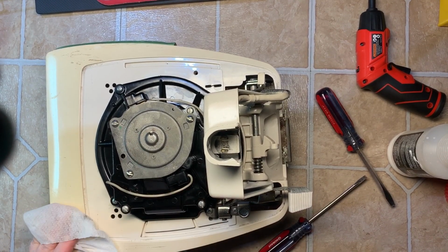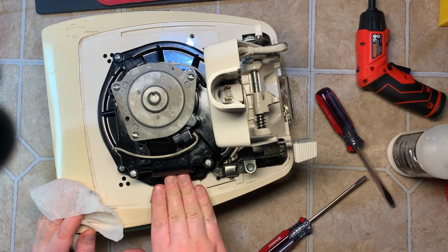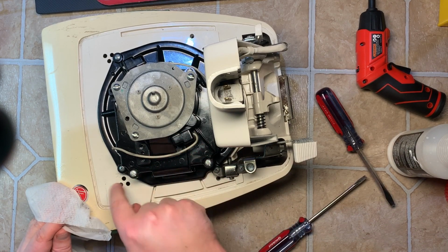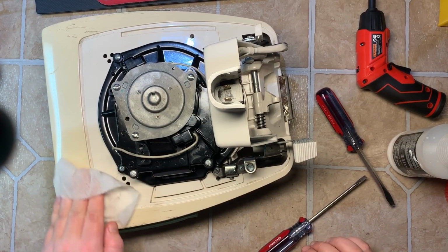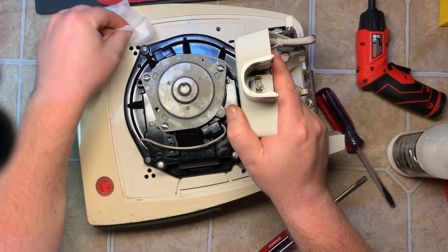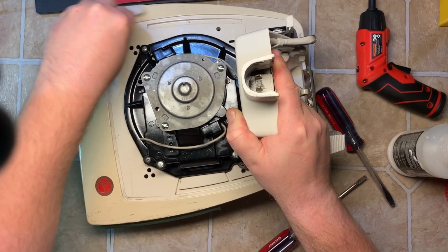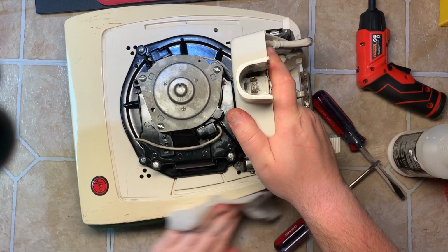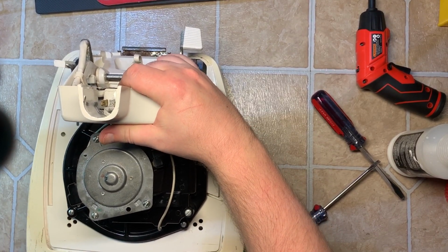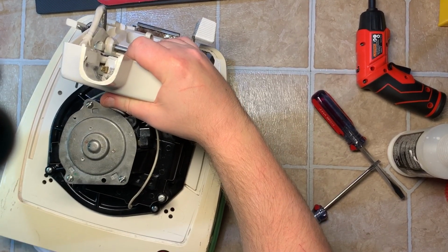That cooling fan in here, what it does, that vent you always see on a convertible, it'll suck air in the side here over the field coil, and it vents out the top, having positive pressure underneath the hood, and it'll blow out any remaining holes, orifices, whatever on top. So it keeps positive pressure in there, preventing most dust from building up. This guard's a little dirty.